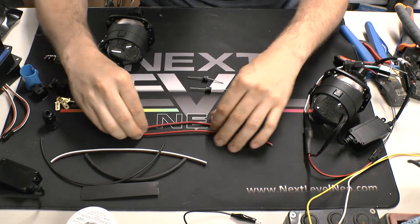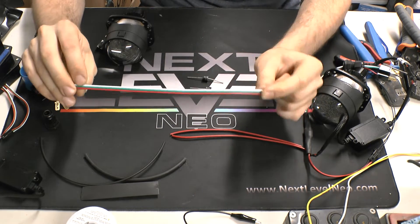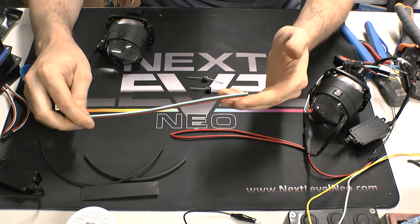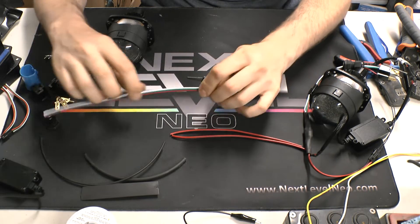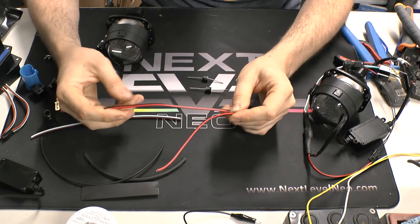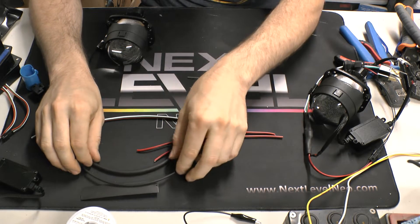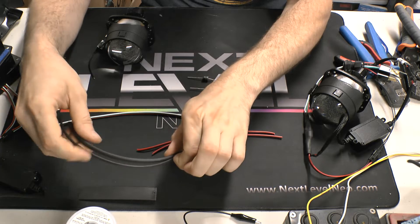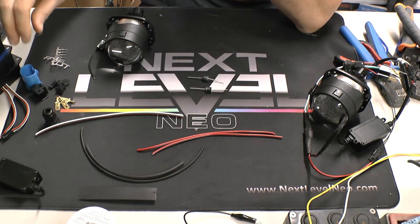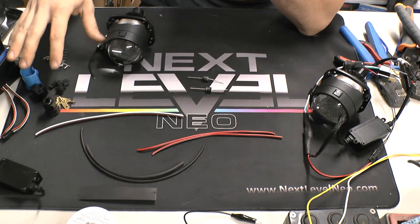You'll also need a little bit of wiring. If you kind of think about it, you've got your three-pin in. I'm just using 18-gauge wire that I use for addressable LEDs — works quite well. I don't go a lot smaller than 18; bigger is fine but might be a little overkill. 18 works well. And then I use 18-gauge two-color wire — black and red — so that'll be high beam and low beam to separate the two. Beyond that, I'll have a little bit of shrink tubing to go over top of the wiring and keep everything safe.